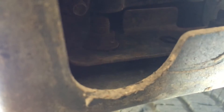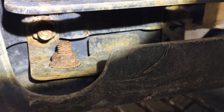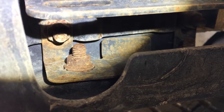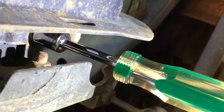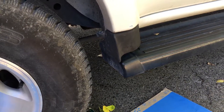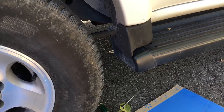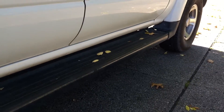There are some other bolts that are pointing up. This is really hard to show you, but there are two nuts there — one towards the bottom of the screen and one a little higher. The one towards the bottom is pointing towards the tire and the other is pointing up. I'm going to try and take off the ones pointing up; I think that might be a little easier. Those are also very tight. I'm going to get some penetrating oil on there. I put some PB Blaster on there and let it soak for a minute, but I couldn't break them loose. I don't want to break the bolts off. I may let that soak a little bit more, but I'm going to go get this one off now.